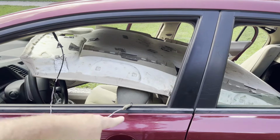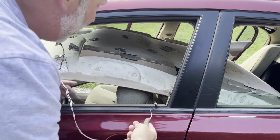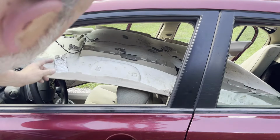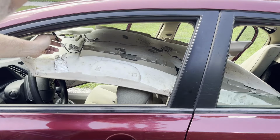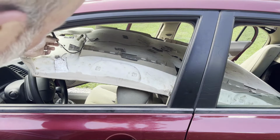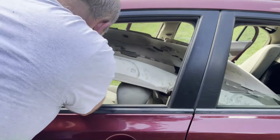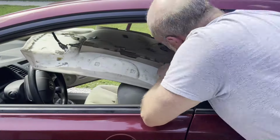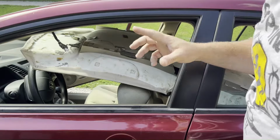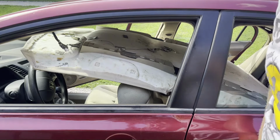Okay, I'm gonna go ahead and get my dome light wiring taped back on, or back underneath that tape that's there. The longer wire goes to the back dome light, obviously. On my wire harness, I got a clue here because there's a piece of the old tape stuck on it. So where the wire harness comes out of the frame of the car, the pillar, that's about where it goes under this first piece of tape. You can kind of feel the wires and see where it's sticky, and that's where it used to be underneath the tape. Just put that area of the wire back under the tape.